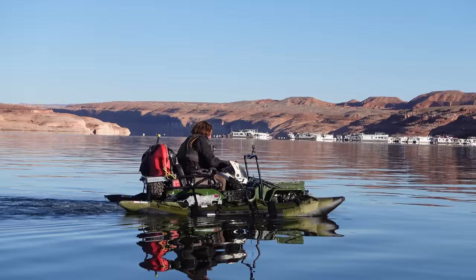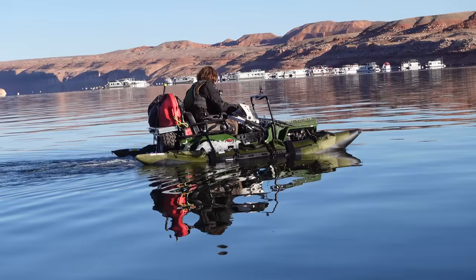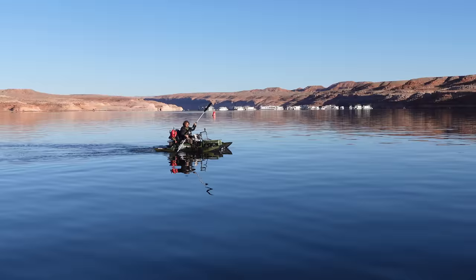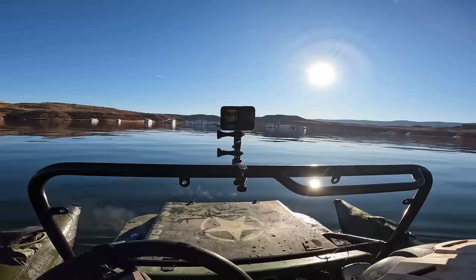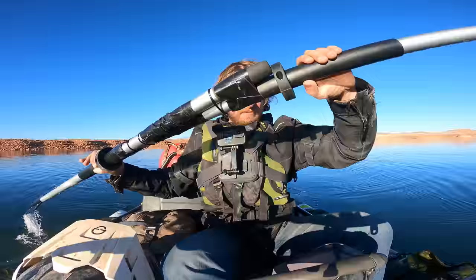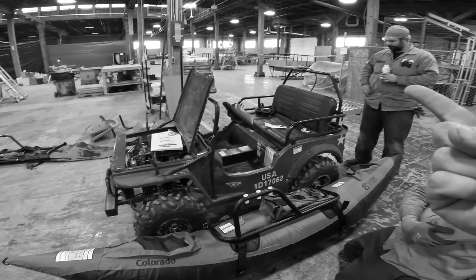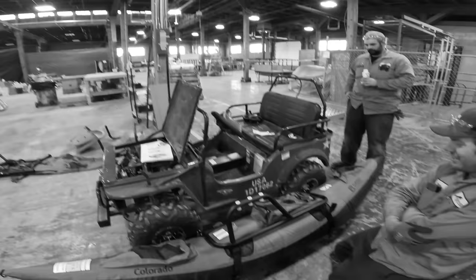I can't actually believe it's working. Well, I say working. Well, that's the engine done. Yeah, I wonder if it's the plug lead. Yes, Ed, I wonder if it is the plug lead. I could just get a, like, jet ski coil. Yeah. And a plug cap. Yeah, like, not whatever the Chinese found in the parts bin.